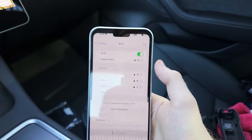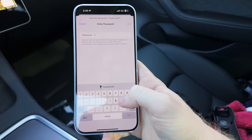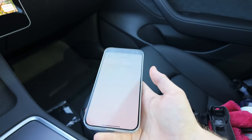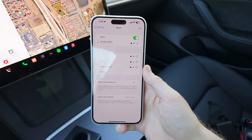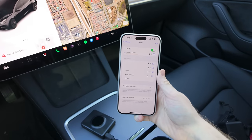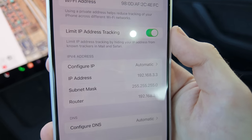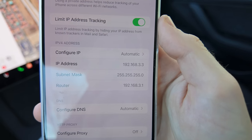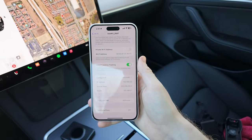Under Wi-Fi, select AutoKit and the password is going to be 88888888 — hit join and it should connect via Wi-Fi to the box. Then the next thing you want to do is connect directly from your phone to the box by finding the IP address. Just tap the little I button and scroll down to where it says router — that number is 192.168.3.1, though it might be different for you. Go ahead and load that up in Safari and you'll have all the settings at your fingertips.